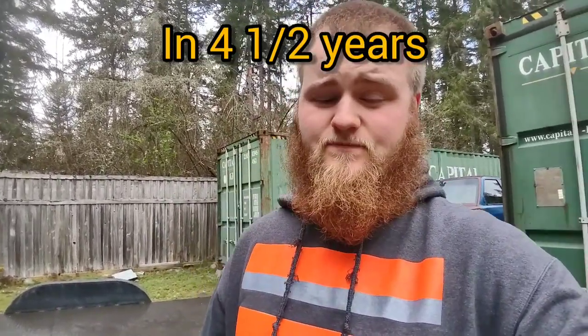If you have a Ram and you're watching this, you're probably aware that this truck comes with a clutch fan, a giant shroud, and an electric fan already on the truck. The electric fan is more or less used for when the AC kicks on — it's not triggered until 223 degrees Fahrenheit. I'm not sure why they set it so high; the clutch fan is the primary fan. My sole reason for switching to the electric fan — it's not power, though it does have a lot more throttle response — is that since I've owned the truck I'm on my third water pump and third clutch fan.